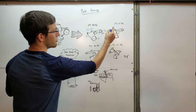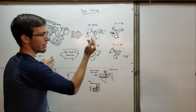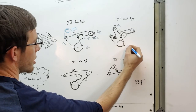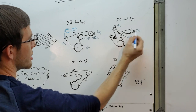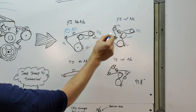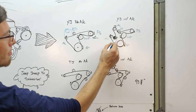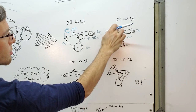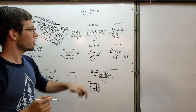Once you've got the idler pulley, you're pretty much ready to install your supercharger. That AC position is where your supercharger goes. Just for reference: crank pulley, water pump, power steering, alternator, idler, other idler — and then we change AC to supercharger (SC). There you go.